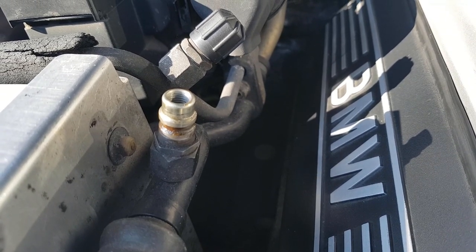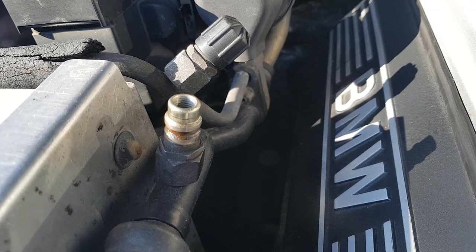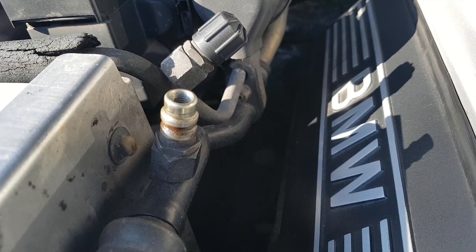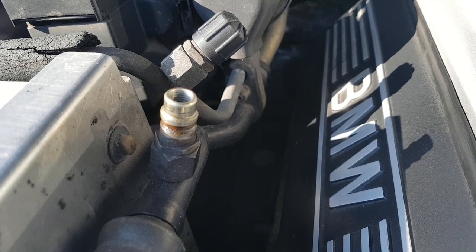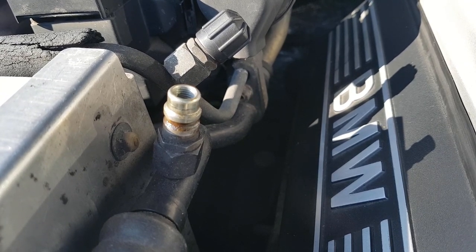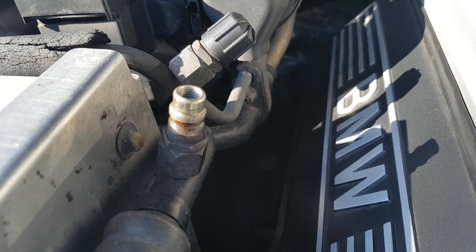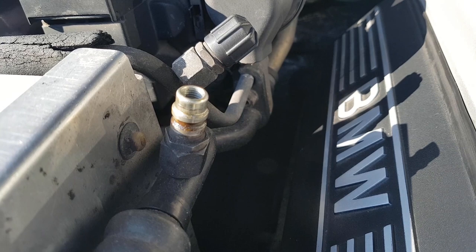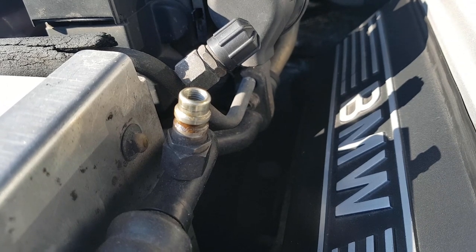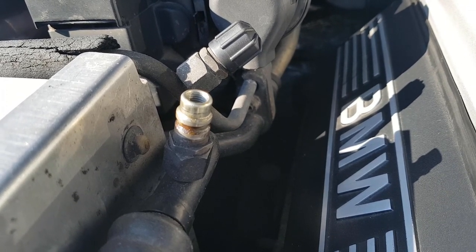Next we get the little kit ready and start the car. If the compressor doesn't run and the auxiliary fan doesn't run, it's quite likely you've got very little gas and a single small can will make no difference at all. But on my car the air conditioning is working but a bit feeble - at least we can check the low pressure side and if it's a bit lower than it should be, we can add gas. It goes in as a liquid, so you have to have the bottle facing downwards toward the valve. You also need to agitate the can - that keeps the stuff coming out, and warming the tin with your hand helps too. You'll notice the tin gets cold as it empties.